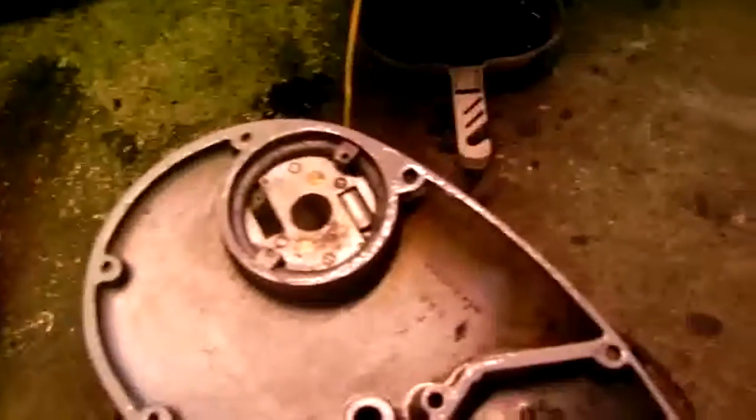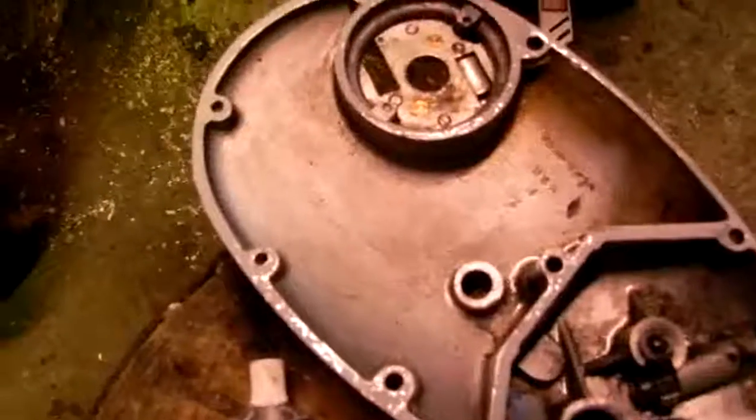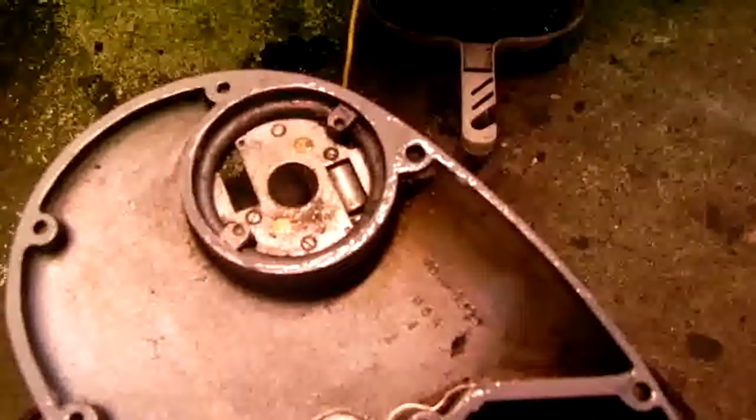The rest of this case should be dry. If you're leaking oil from your 441 or V50 or 250 from the front of the timing case, then your bushing in your cam to the engine is loose, and it is pouring oil out.